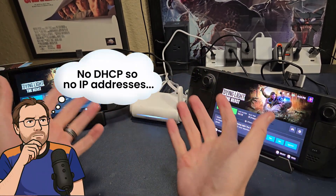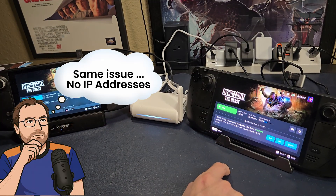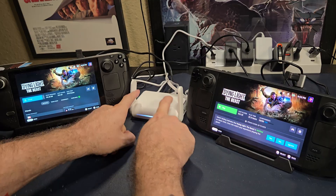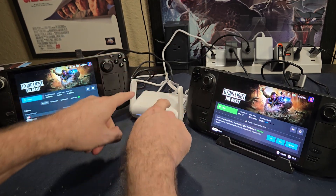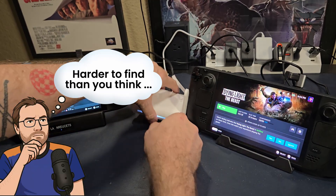You can't just plug a cable in between them — that doesn't work. You can't just put a hub in between them because that doesn't work either. What you can do is what I set up here. For about $35, you can buy a special travel router. This travel router is special only because it has multiple local area network ports.